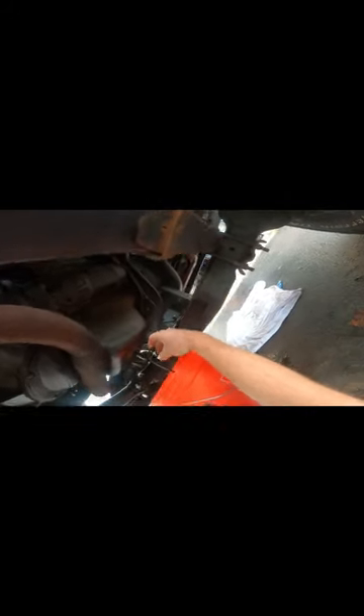We're gonna go ahead and start by draining the oil. I've already warmed up the truck so we won't have any issues with it being extremely cold and having struggles with it all draining out completely. You always want to warm up your truck or car before an oil change, especially if it's a diesel, because you want all the oil to drain out. Now it's not too hot, not too cold. We're gonna drain all that oil out in this five-gallon bucket.